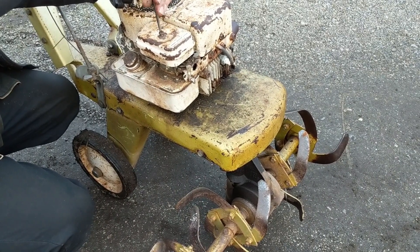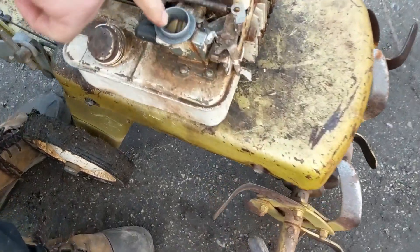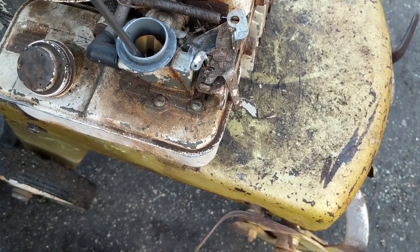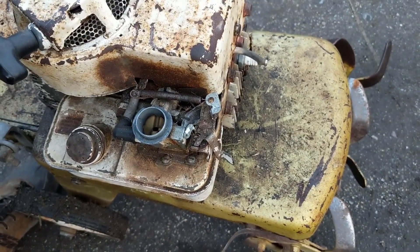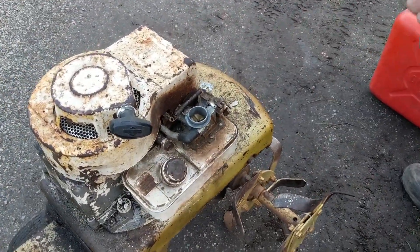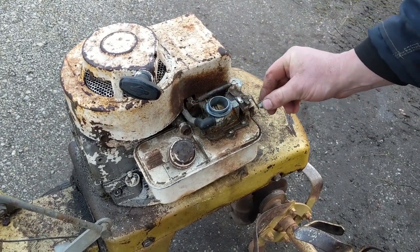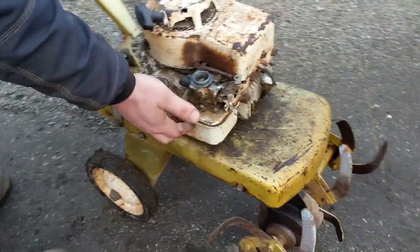This machine has an automatic choke on it. Basically when the machine's turned off, the little choke valve goes to the closed position, which makes it easy to start when it's cold. When it starts to run, this little valve opens up. This thing probably hasn't been running in years, so we're going to squirt a little prime in there with our little handy dandy fuel squirter just to get her started. It looks like someone's gone and adjusted it to the run position. So let's give her a couple of pulls and see if she sucks any of that gas we put in the tank.